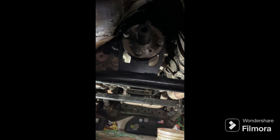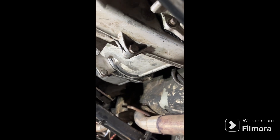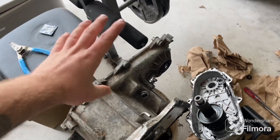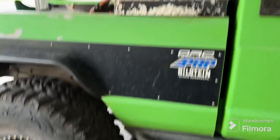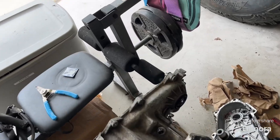Right now, the last time I went out to Barnwell I was having some issue with the transfer case, so we're gonna dive into that. Here's the Jeep and I have the transfer cases blown apart. This is the rear 231 — the rear case, the back half. This is the front half, this is the plate that mates it to the front case, and there's the front case right there.